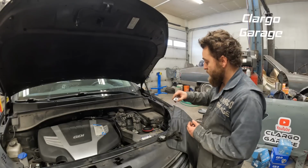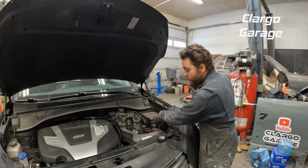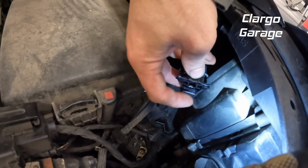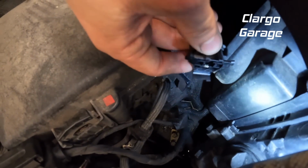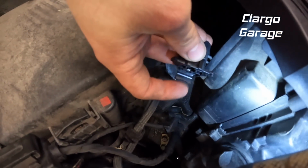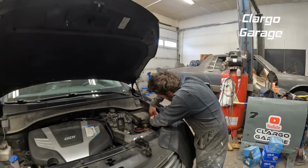So now we're going to slip this back in the socket, and we're going to make sure that this tab goes with the groove on the socket. And when I say the groove on the socket, it's hard to see, but on this bottom part there's a little tiny notch. I'm not sure if you can see that or not. That might help a little bit, maybe not. But that's where that tab goes, is right in there. So we just slip it in, never touching the glass.